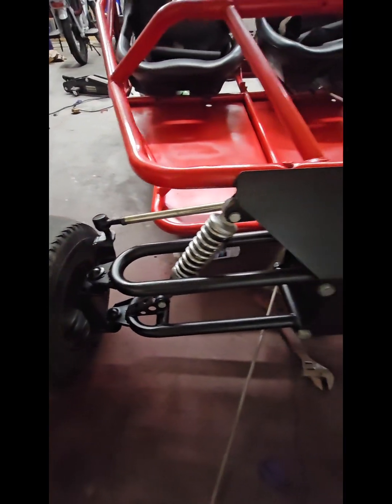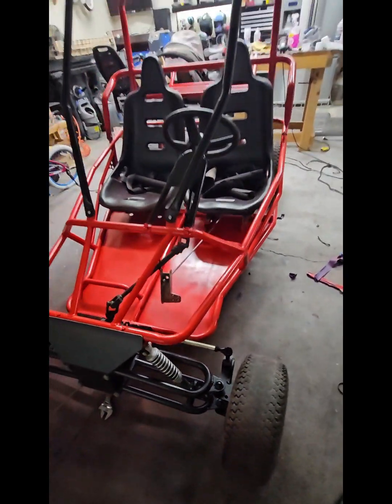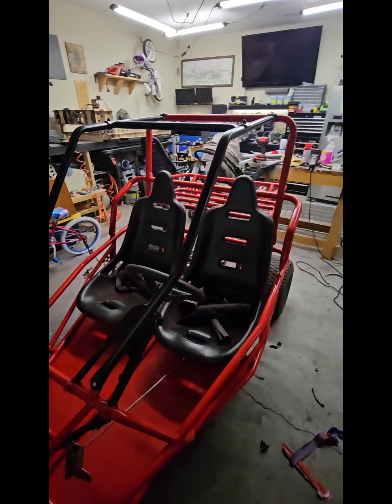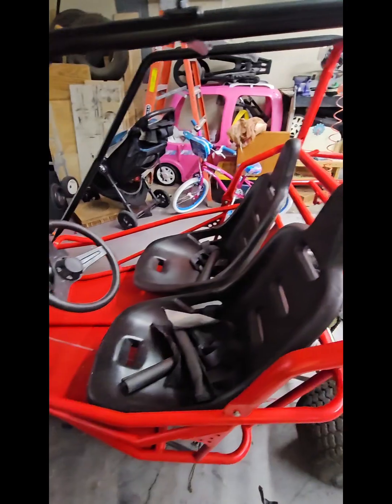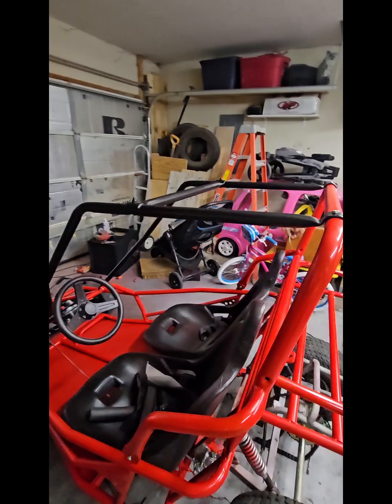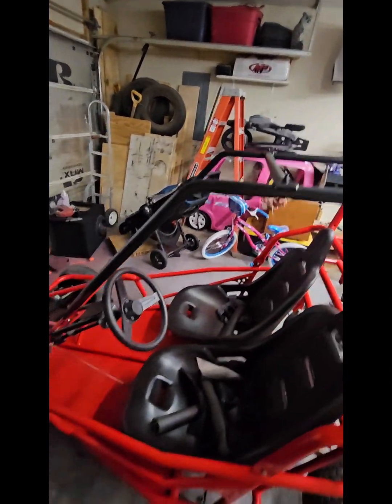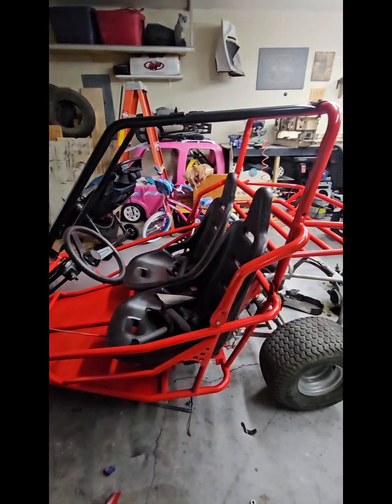Here's where I finally got it together. I changed out some axles, I changed out some bearings and joints — just made it as sound as I could because I knew what I was doing to it was going to add a lot more power than it was used to. I also got a new reinforced axle for it. I broke the original — the torque just kind of snapped it — so I ended up doing the axle.